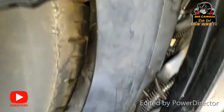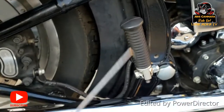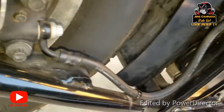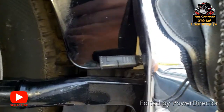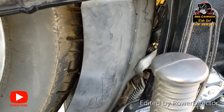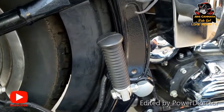In order to get to that plug, you're going to have to remove your splash guard right here. This is a really easy job — you should be able to do it right on the side of the road. You need to get to these two bolts down in here, then this splash guard moves up over the tire and out of the way, exposing all the wires on the back of your battery box so you can work freely in that area. This is about a 15-minute job once you're in there. Nothing to it — it's really an easy fix. Don't take it to your mechanic unless it's under warranty.